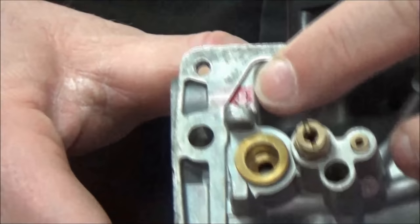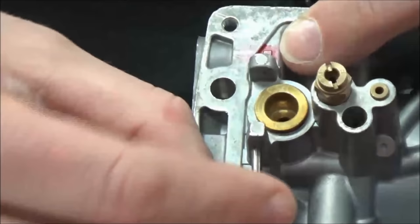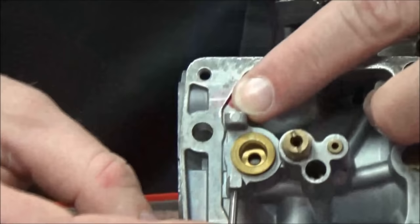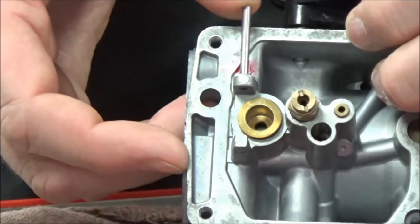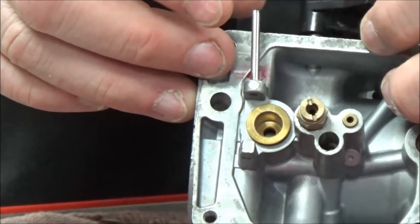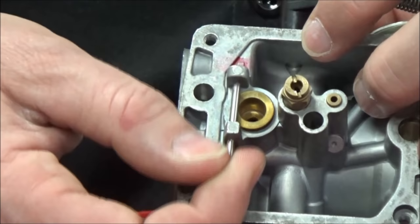Before we get ahead of ourselves on disassembly, we talked about this arrow — that was the direction it gets removed. That means the diameter on this side compared to the other side are different sizes. The side closest to the arrow is actually smaller in diameter than the other side. So the pin will go right in on the small side, but on the other side it will be a pressure fit so it won't fall out. Harley's the only one I know that did this.